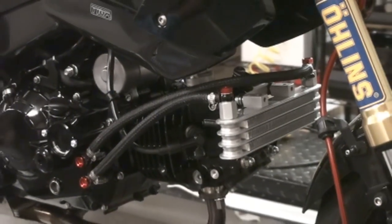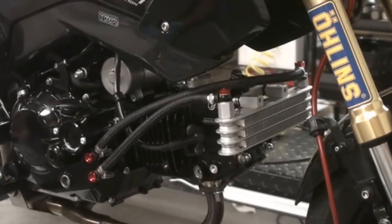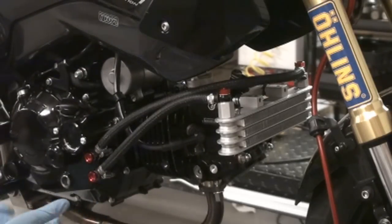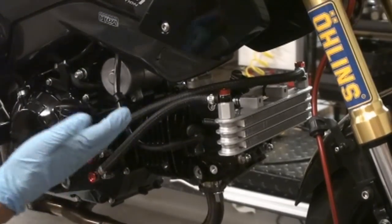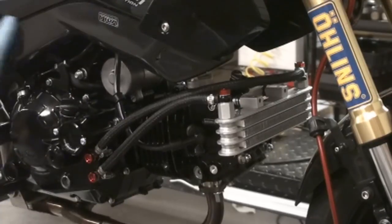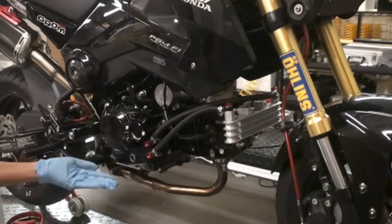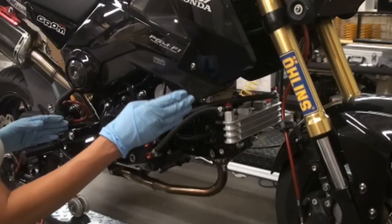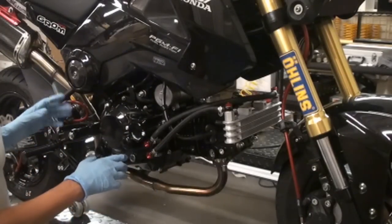The last thing is to fill your bike with oil, then let it idle for a few minutes — this is very important so you can inspect everything thoroughly to make sure there are no oil leaks. Inspect your fittings, bolts, and cover. Do not go out for a ride immediately after starting the bike; let it idle to make sure everything is working properly and there are no leaks. If you're adding the super oil cooler, note that it takes a little bit more oil, so watch your sight glass when filling.